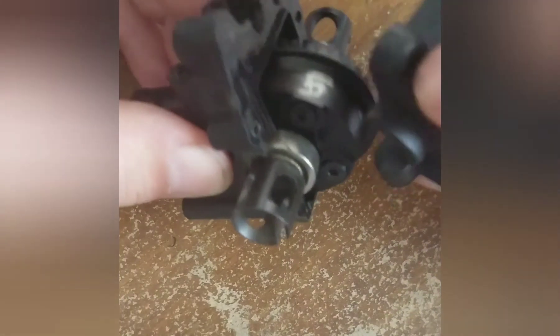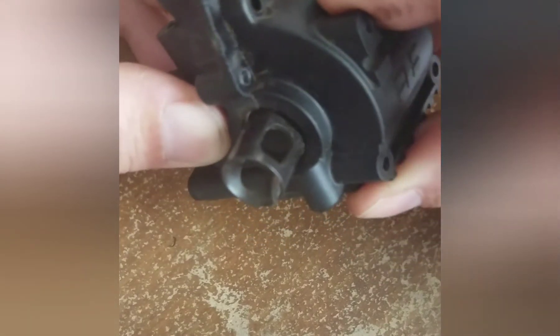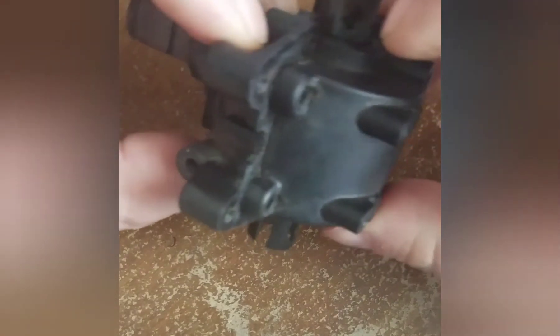Just like we put the diff in on the shim side first, I'll also kind of angle the diff case and fold it over, then bring it in on the other side. And then it's in there perfectly.